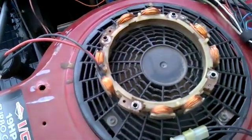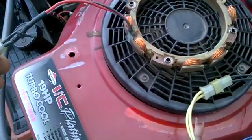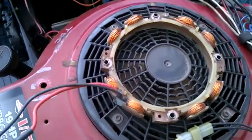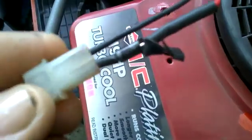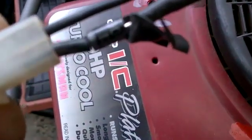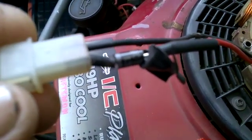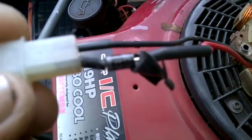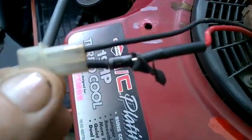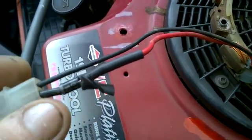The original style alternator on this engine is a kind of dual AC/DC semi-DC alternator that runs underneath the flywheel with its magnets. Half of the output is pulse DC, with a diode that blocks the AC, so you get a kind of 12 volt plus 12 volt pulse. The other side of the AC is blocked, and it also has an AC output for running filament-style bulb lights, so it can charge the battery.